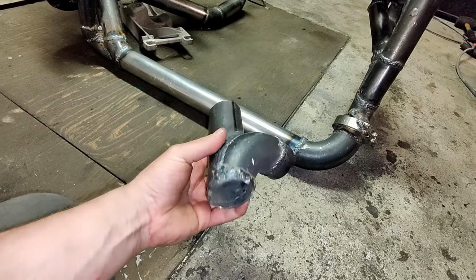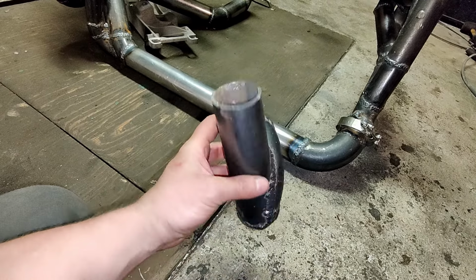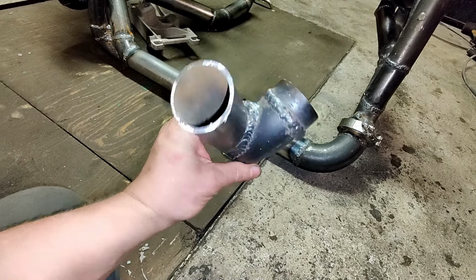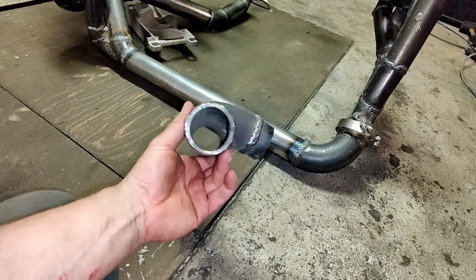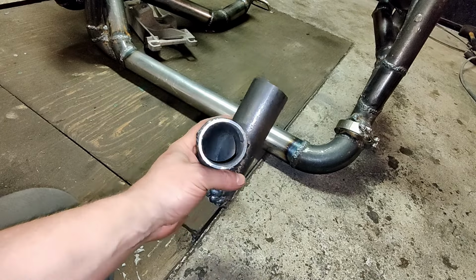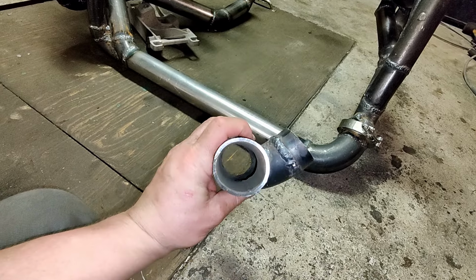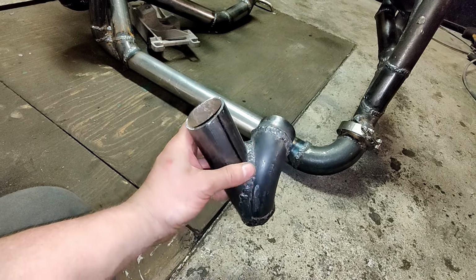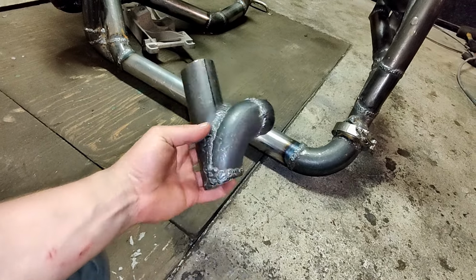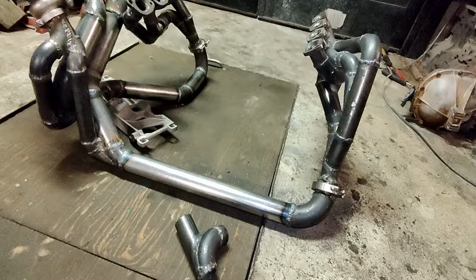But with the M50 Turbo Scorpio, I have driven 13 years and over 100,000 kilometers with the same exhaust manifold, with the same manufacturing design. So just don't wrap it in heat wrap, because if the material temp goes up due to the insulation on the outside, it will just vanish basically. So I'm not gonna wrap this up. That's it for the disclaimers.